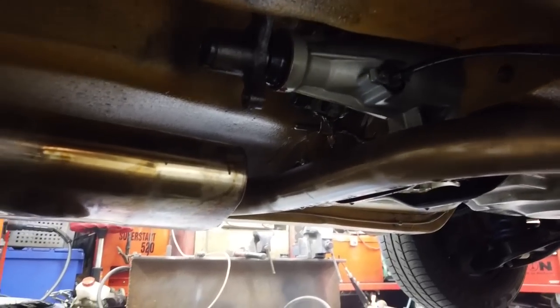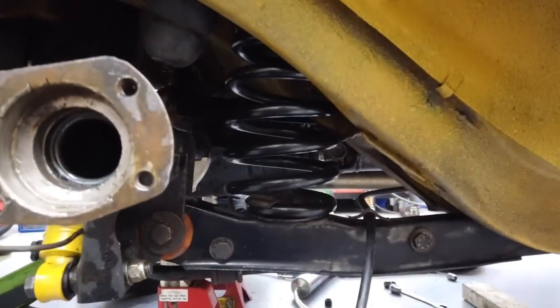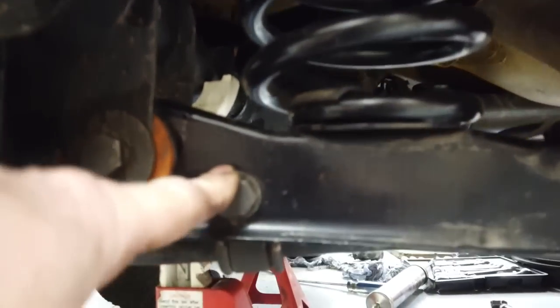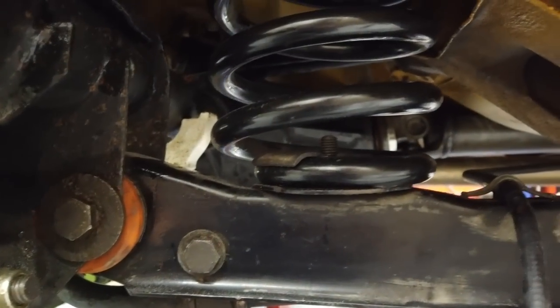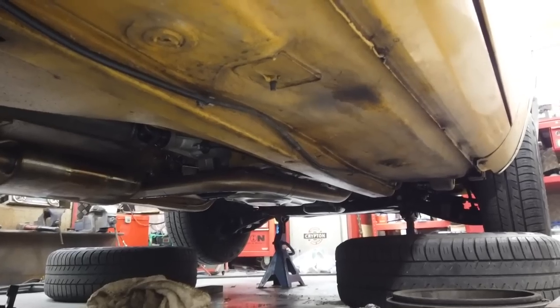We're going to carry on now, that's enough waffle. With the axle back on and the angles checked, we're getting the figures that we want. The adjustable serrated plates are just the other side of the bolt here. So what we did, check the angle, so I had 4 degrees pointing down in the end on the gearbox output shaft.